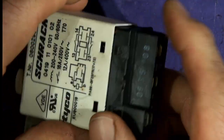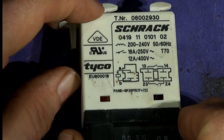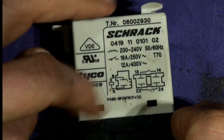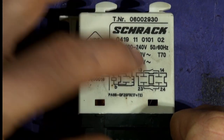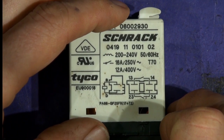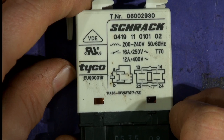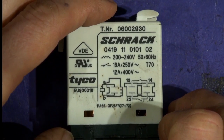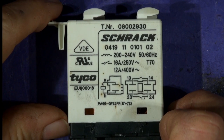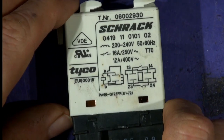Now quite often when the Miele dishwasher powers up and you press start, the drain pump starts, and then this kicks in. And although the dishwasher doesn't want any heat at this point, it just cycles this relay, and somehow there must be a wire sensing the relay has closed and power has got to the heater, so that it doesn't fill up with water and sit there going cold trying to wash for hours. It's some kind of interlock — I'm not quite sure why they do it. Others just let your dishwasher run cold, and some of the Bosch ones just go on running for absolutely just about forever without ever stopping, until you drain them — and you have to bail them out, or if you know the shuffle of the buttons on the top, you can cause the drain pump to cycle and drain the dishwasher in engineer mode.